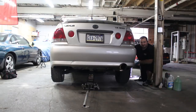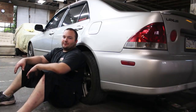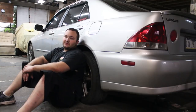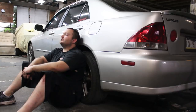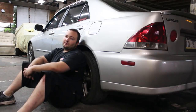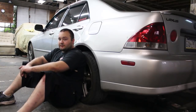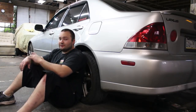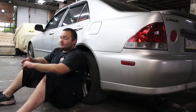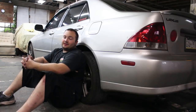That's how you fix the annoying brake noise with the IS-300. I hate drum brakes — that's why I put the hydraulic handbrake in the Supra and deleted that. But this is my daily and I'm going for the VIP look, so I didn't convert to hydro. Now I fixed the problem and I'm so glad I fixed it — I've been waiting way too long to do this. I did use a cutting blade on my angle grinder. You don't have to — you could use a file or a Dremel, really anything to remove material, but a cut-off wheel is probably the quickest. Make sure you don't get any metal in your ear. Hopefully if you're having this problem, this video helps you out. I hope you learned something, I hope you enjoyed it, and I will see you guys next time.